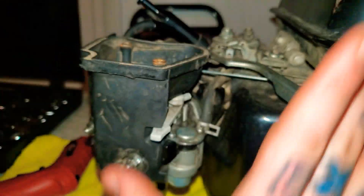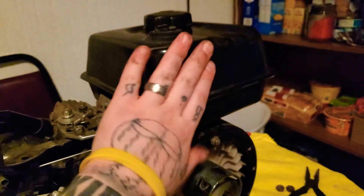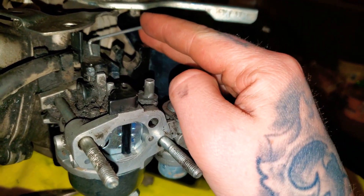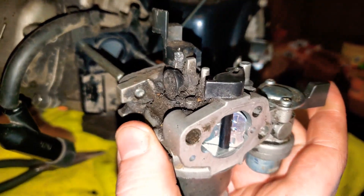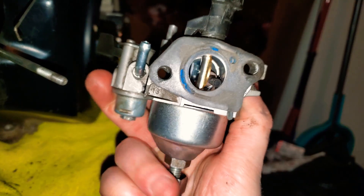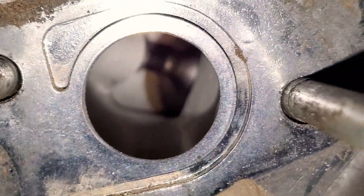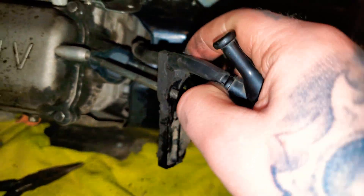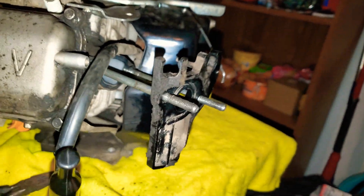We got to get this carburetor off — and it's missing a whole cover right here. We got this hose off, and a little bit of gas came out of it. Next we got to take off the gas tank. So right here is the carburetor — I got this little rod off finally. And now this old carburetor should come right off. We ain't going to be needing this one because I am going to be ordering a new one. As you can see right there is where the air goes, and this little guy right here is what pretty much holds the hoses and stuff. We'll take this off and clean it.